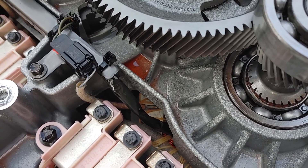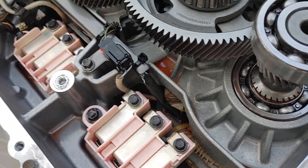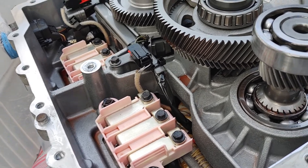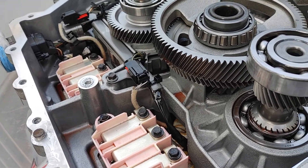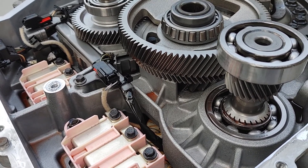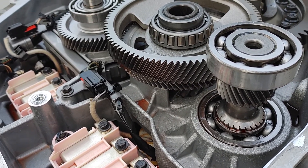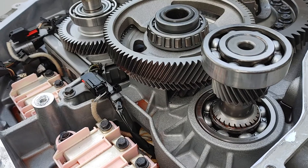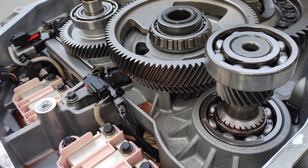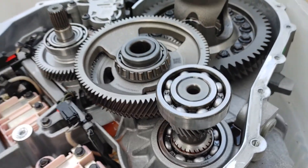A synthetic fluid wouldn't oxidize. Seeing that fluid color made me think the fluid hadn't been changed by the original owner — either they didn't have transmission problems, or they had problems a long time ago and the fluid has already oxidized, or there's really something bad and carbon is being ground into the oil. I checked with a magnet and it didn't seem like there was a lot of metal in the fluid, which still didn't help me determine whether or not the gears were good or bad.